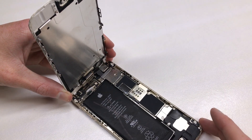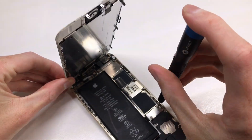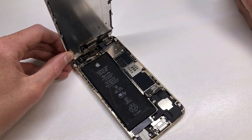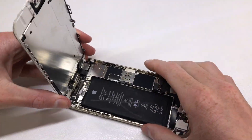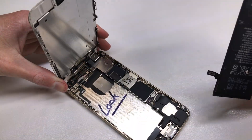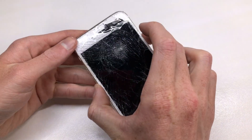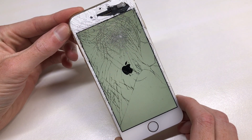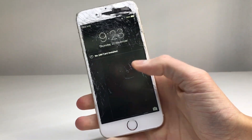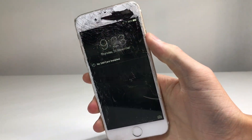It sort of means that this battery has been put in here because it doesn't work — taken out of a device where the battery is known to be bad, but installed into this phone. It was held down by a small bit of adhesive, not the original stuff, and underneath that there's a giant piece of text that says 'lock', underlined. So at this point I was thinking that maybe the logic board had been swapped from a different phone to one with an unlocked IMEI number on the back to make it appear to be unlocked.